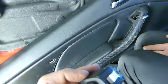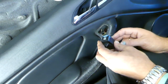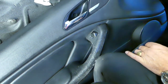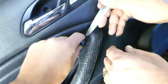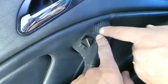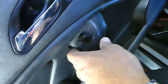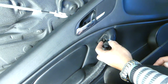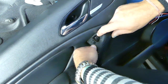I'll attempt to remove the mirror switch without the door panel to show you what happens. If you use a small knife you can pry one side up, but we caused damage doing that — so avoid it, guys. Just remove the door panel. With the door panel off, you stick your finger in the hole and push it straight out — you can see how simple it is. Avoid damaging your interior trim. That's how you remove and replace the mirror switch. Please subscribe and many more videos to come.